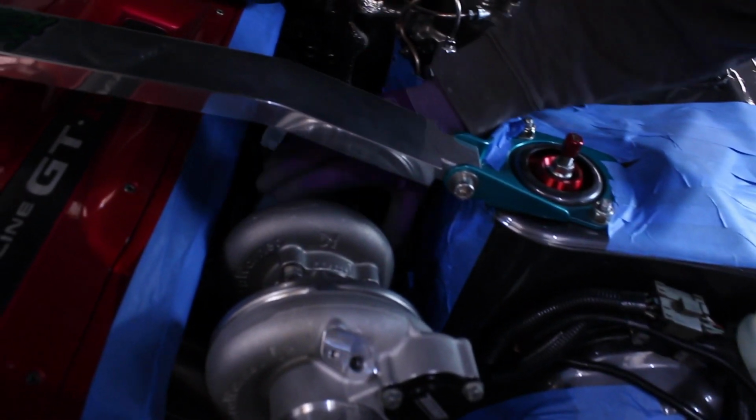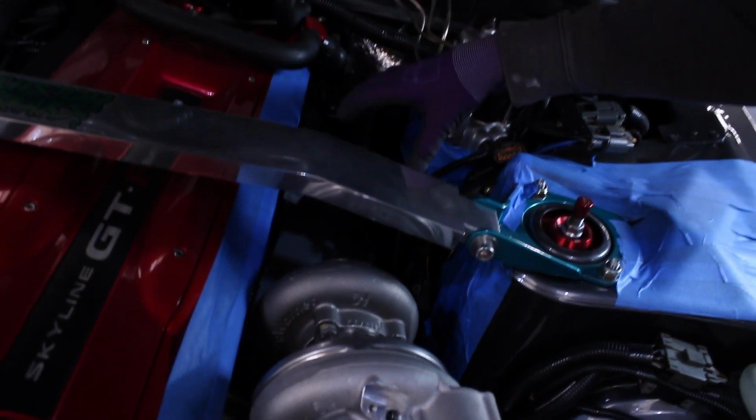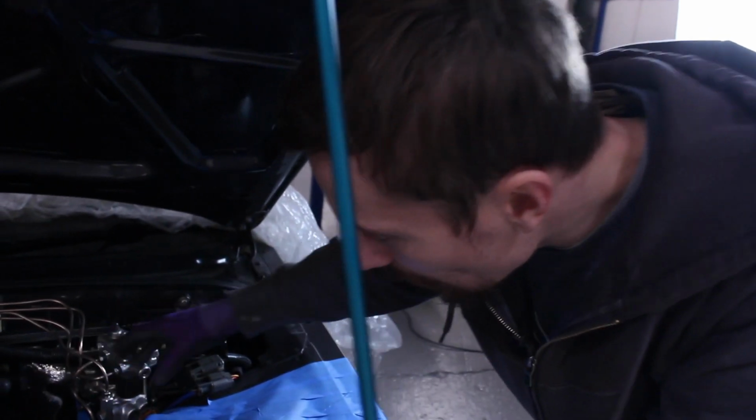So we're going to do our best to try and... The rear turbo was the one that I had the biggest problem with. So I'm going to put the front turbo and manifold back on, done that now, get them roughly in the same position they were, and put in a mock-up downpipe. It doesn't really have to go anywhere, I just want to take in the space of where the downpipe would go. Then I'm going to put another turbo in the back and offer up a downpipe for that, and then see if I've got enough room.